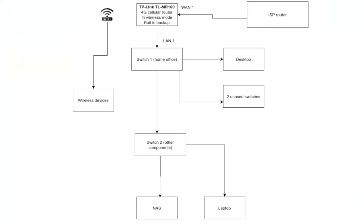Two setting changes and now everything's hooked up. This Wi-Fi network, instead of being a Wi-Fi network just from the ISP, has fallback or backup internet built into it. It's going to be primarily a Wi-Fi network created from the ISP connectivity, but in the event that drops, it's going to switch over to cellular-based connectivity.